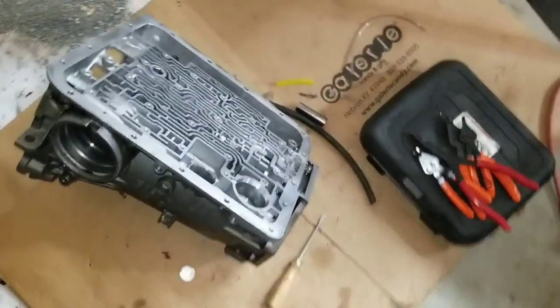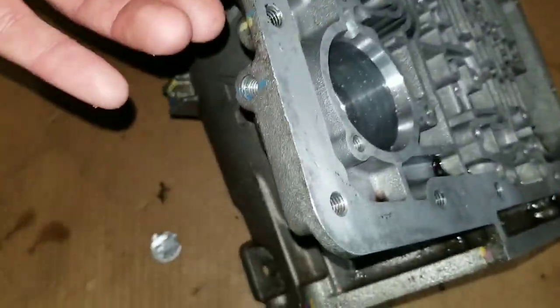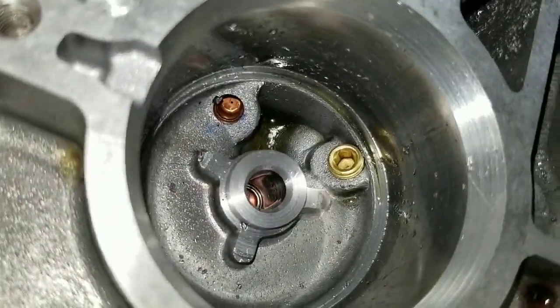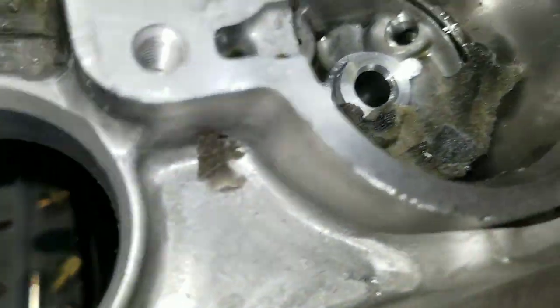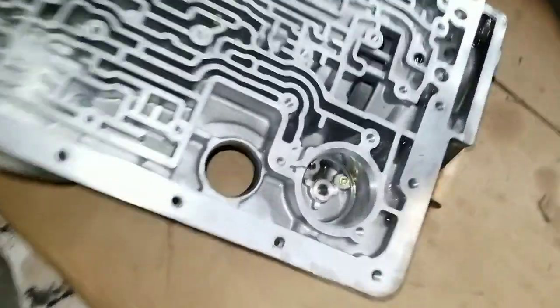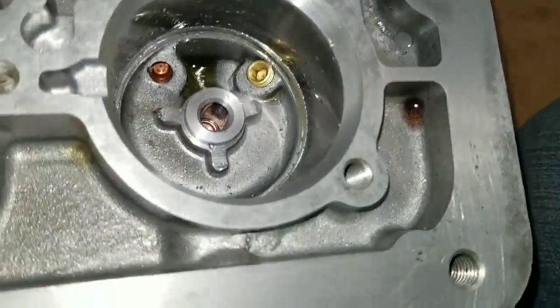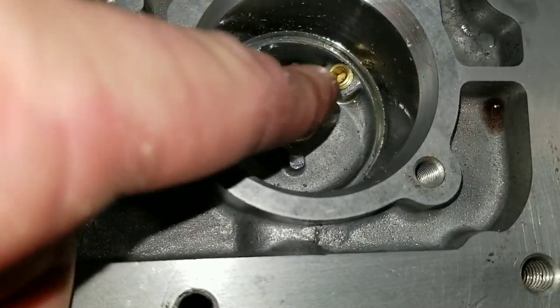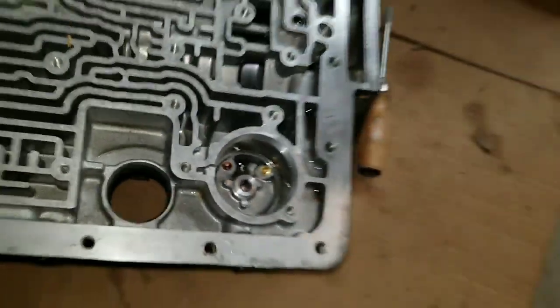On this case, there's where the hole is. I have this other case that's no good — showed in the previous video how the lugs down in there are destroyed — but I just have this in here so I don't lose it right now because I've got to wash the other one out. This one looks different; you can see where that is in relation to the wall and the angle of that face versus the other one. I did a test run with the tap I just ordered — figured why not practice — and this one went in really easy. I did end up a little bit off-center but it works just fine.